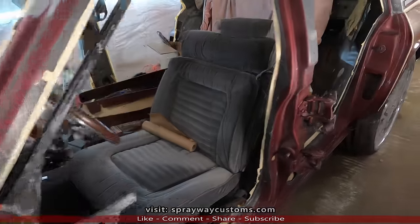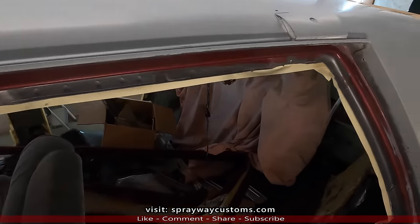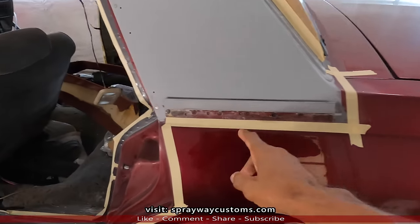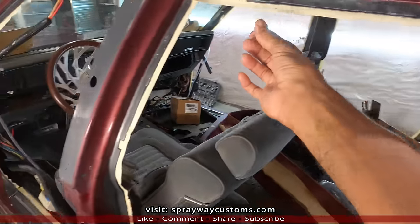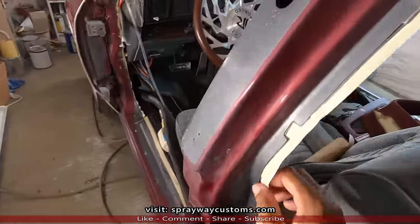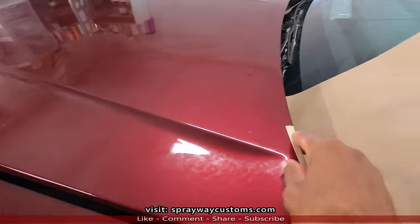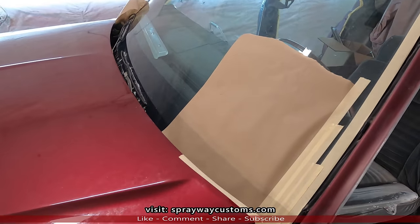The next day. Here's the following morning. I did all this last night. Went on and did the masking. I just gotta put some plastic over the entire car. Then I cut out everything. I got this back mask here around the jams. Now I sit up, go outside and set up the booth. Then we'll pull the car in. Hopefully we can get it started before it get too hot.